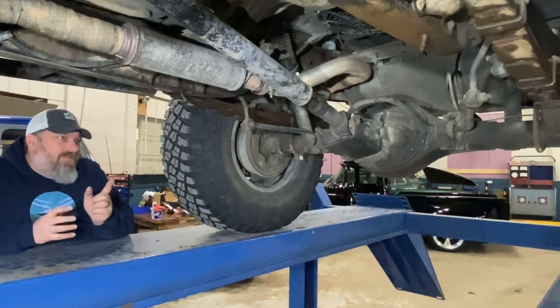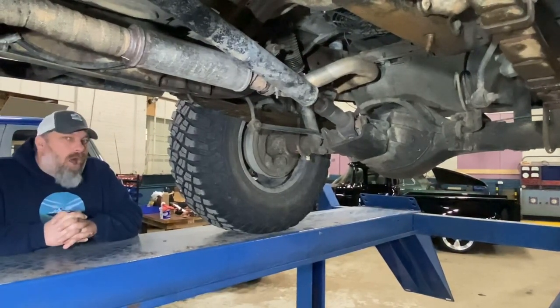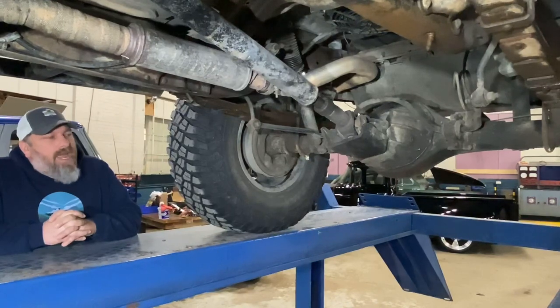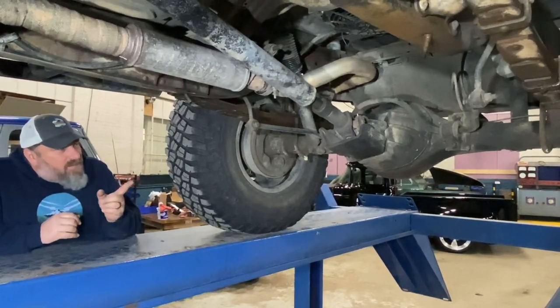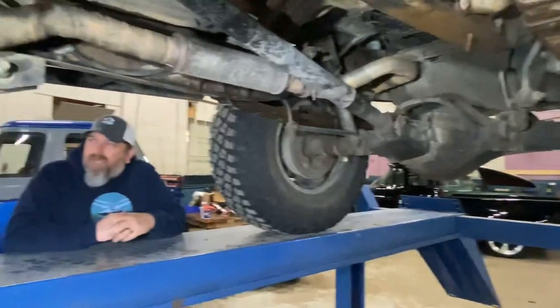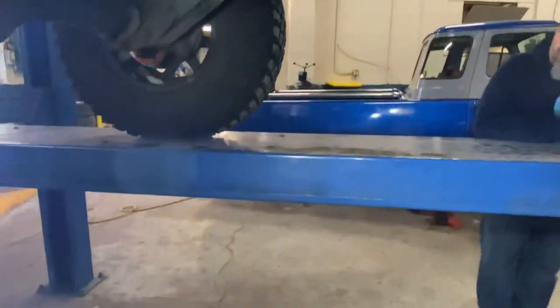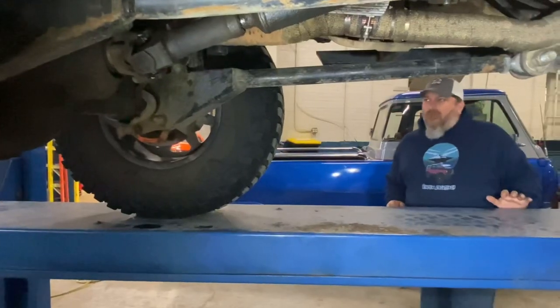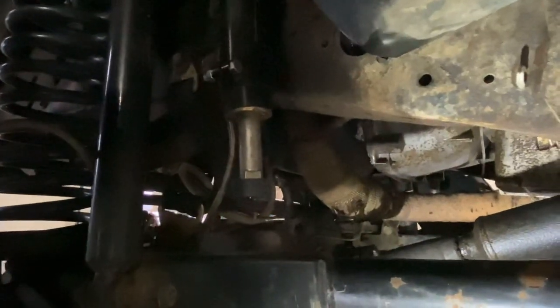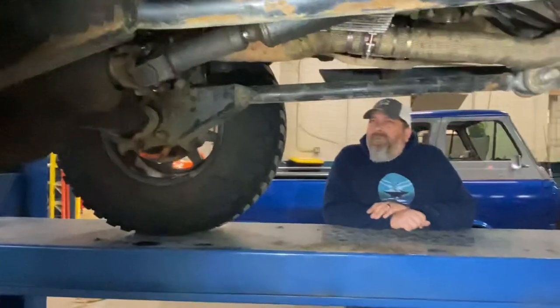Like I said, the driveshaft I had made locally. It's actually a .250 wall DOM driveshaft because I completely pretzeled the last one that I had. And then I just have some normal bump stops in the rear for this. I did forget in the front here, you can probably see on the James Duff arms, I do have a set of Stinger Daystar bump stops that use the little crushable cushions inside the cans. So that's what I have in the front. And then also you can see the limit straps and the other MS-2020. Anyway, the James Duff front shocks up there, I forget what they're called anyway.